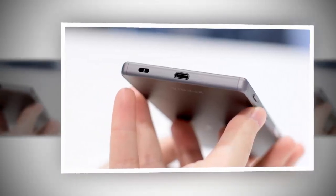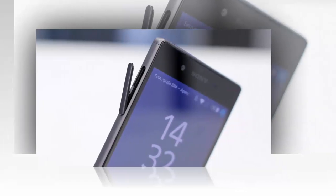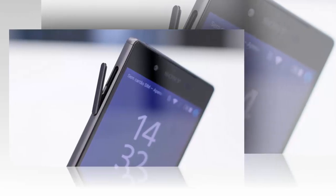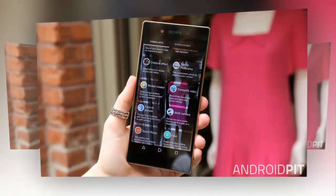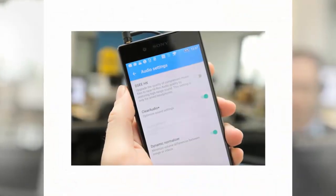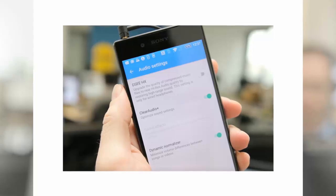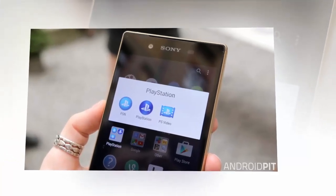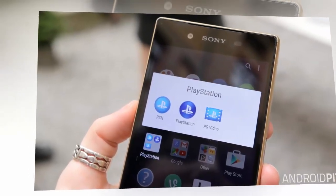If your Sony Xperia Z5 is freezing or lagging, trying out safe mode might help you to identify the problem. The thinking here is that an application you recently downloaded may be having an impact on performance. To enable safe mode, turn off the Sony Xperia Z5 and then press and hold down on the power key until you feel a vibration. When you see the Sony and Xperia logos, press and hold the volume down key until safe mode appears on the screen. When you activate safe mode, only applications that ship with the device load up. If you notice an instant improvement in performance, it's likely something you downloaded is doing the damage. If that's the case, get rid of some recently downloaded apps or run Sony's PC companion tool.